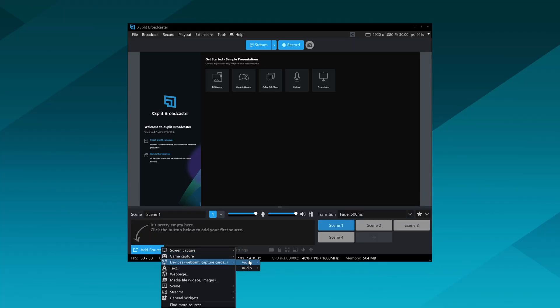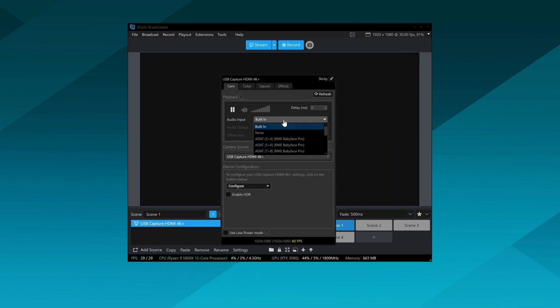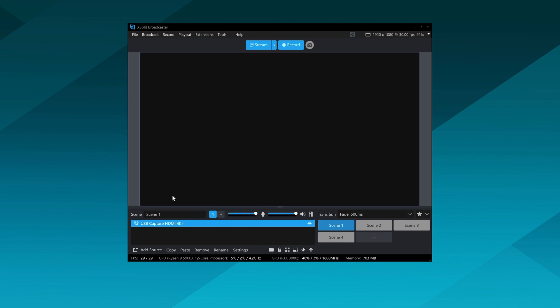I know there are other ways to do this, but this is the easiest way to handle sound and audio. Plug the Chromecast into the capture card, then add the capture card as a source in your streaming broadcaster. Depending on your capture card — especially with the Magewell — you might need to set the audio input on the capture card separately, as it's sometimes treated as a separate source. Make sure to pull the audio in from the HDMI.